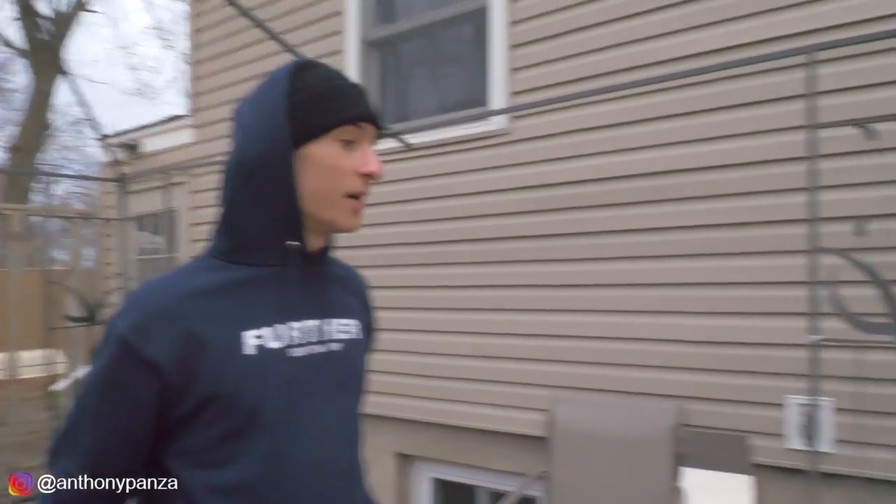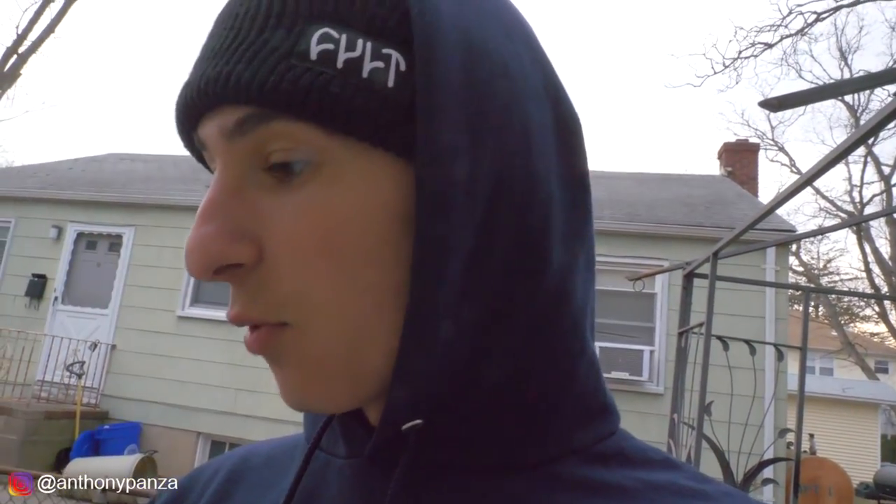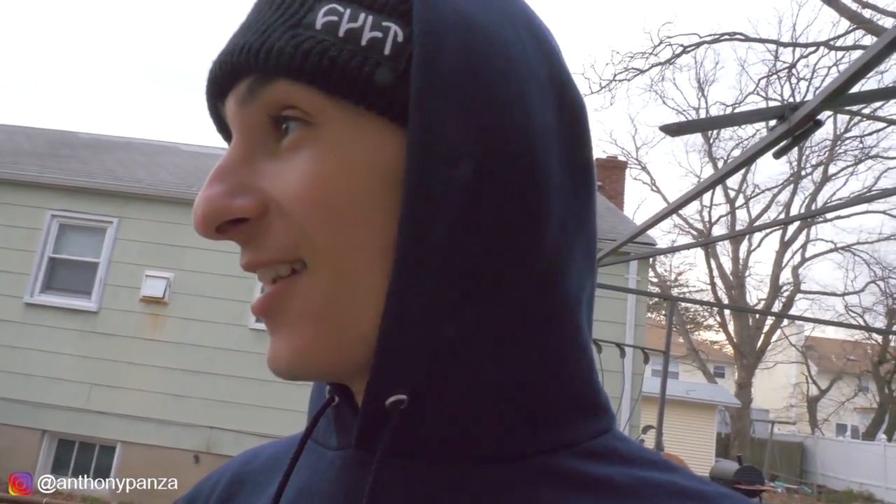Me and him are about to go to the skate park to test out the bike. This took me all day long — no joke. I woke up this morning, stripped the frame, had to sand it, which was about three hours, then painted it, then put it all together, and it's already 6 o'clock. If you ever go to paint your frame, make sure you spend the whole day doing it — you can't do it in an hour. If you think you can just go out there with a can, it's not going to happen. Also, make sure when you're spray painting your frame you've got nice weather, because today it was a little cold and windy and that will mess up the paint. The paint sticks much better when it's warmer.